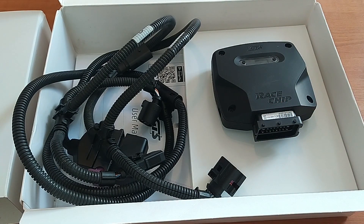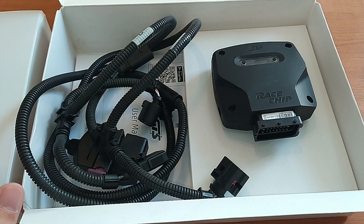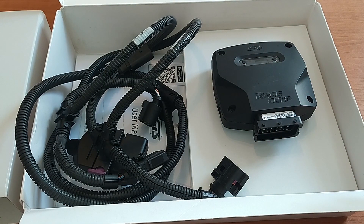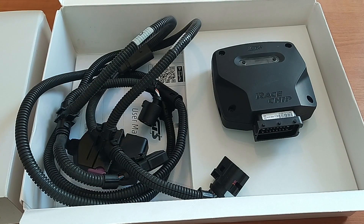The box can only work in the headroom left by the manufacturer to compensate for altitude, fuel quality, temperature, or things like that. So before I install it, I'm going to make a few predictions and then we'll find out which one comes true. I do believe it is possible to gain some mid-range torque, though how much will depend on things already discussed. At low RPMs — below 1400-1500 RPM — it will do absolutely nothing, because the whole premise of its function is based on manipulating boost. No boost, no gains.